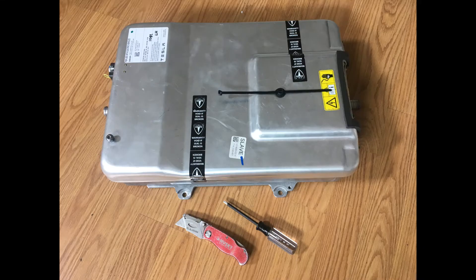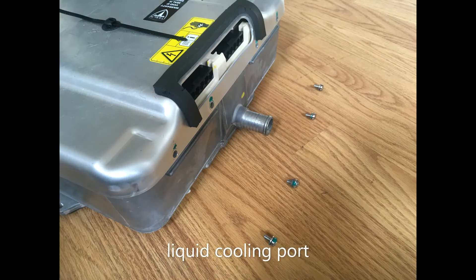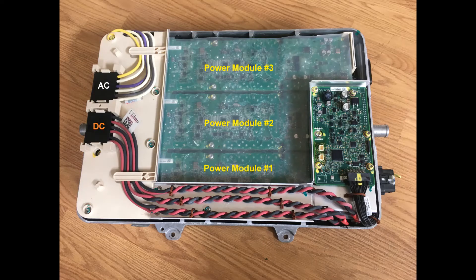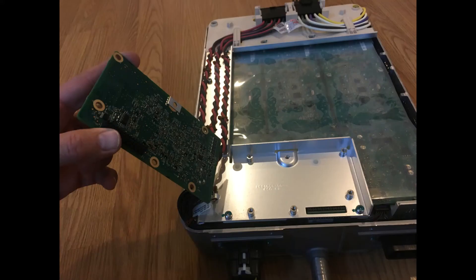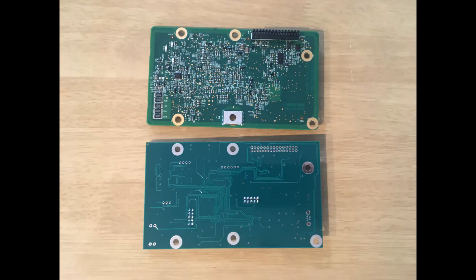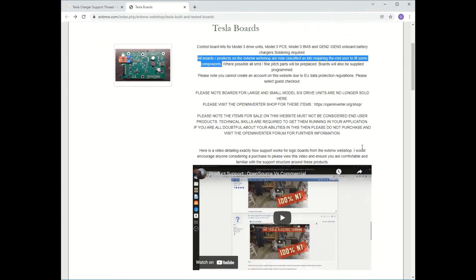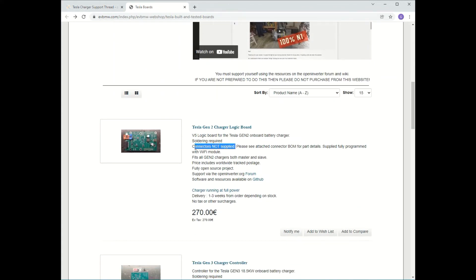This is not just plug and play. It requires some elbow grease, so let's find out if a guy like me can pull this off. The three power modules inside the Tesla Charger are just bricks if there is no controller to control them, and outside the actual Tesla, the charger is a fish out of water — completely useless. So we have to R&R the OEM logic board with an Open Inverter one. Although Damien Maguire does all the heavy lifting for us, his boards are sold as kits, meaning it's up to you to complete them. Also, not all the parts are supplied — it will be up to you to source all the necessary connectors.